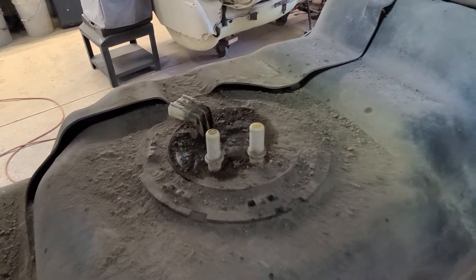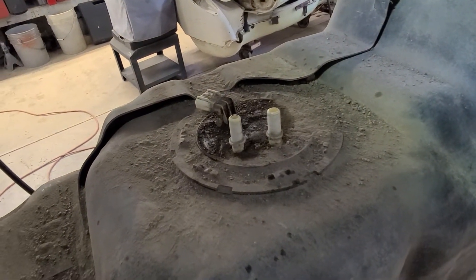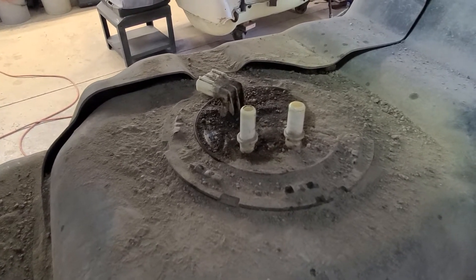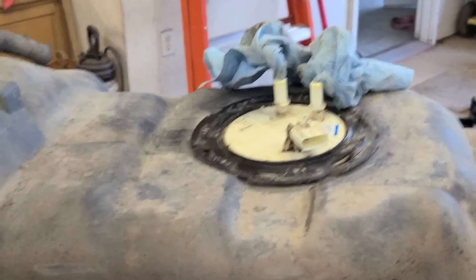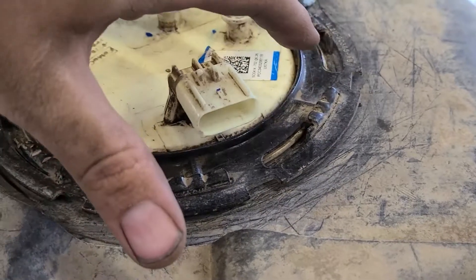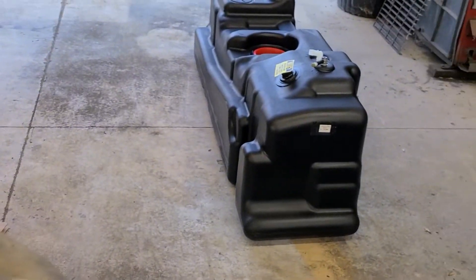This is really, really dirty — full of dust and dirt. There's a really good chance there's going to be dust and junk in the tank, so I don't know if I'll even be able to save any of this fuel. I'm going to try to clean this off so I don't get junk and dirt in the tank and can get this O-ring and seal off of here. I finally got it cleaned off — that was caked with like 5 pounds of dirt. Now it's pretty simple: just take a hammer and a large screwdriver, hit it along here, spin it counterclockwise, and this lid will come off so I can transfer it into the new tank.